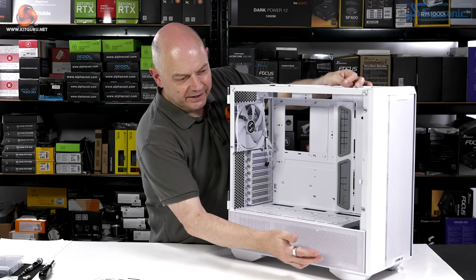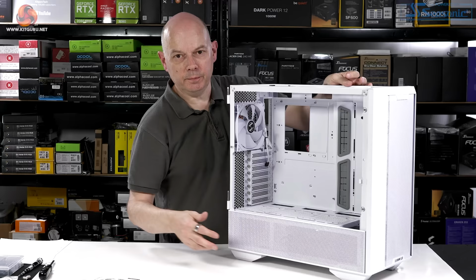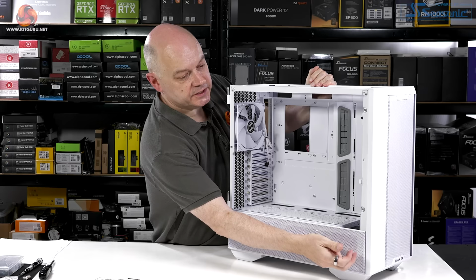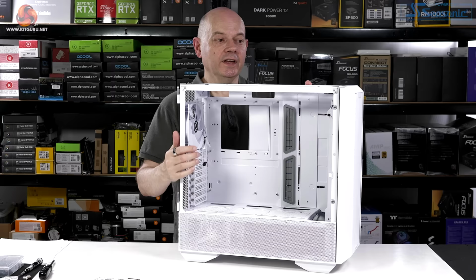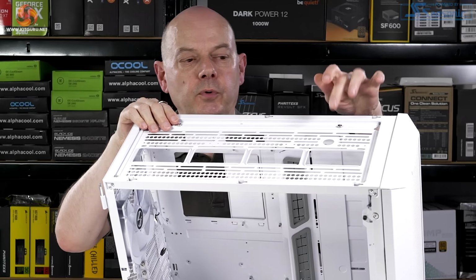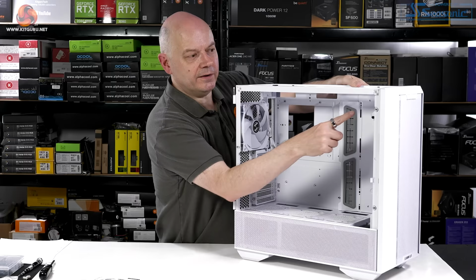I think this configuration looks a bit odd. For the front I/O to make any sense at all down there, your PC is going to have to be up on your desk and probably pulled right to the front so you can actually plug things into those ports. But on the plus side, that top front corner is now opened out. And remember, the fill port for your liquid cooling is on that top bracket in that approximate area. So if you're going custom loop and if that front corner is important to you, shifting the front I/O down is going to help you.